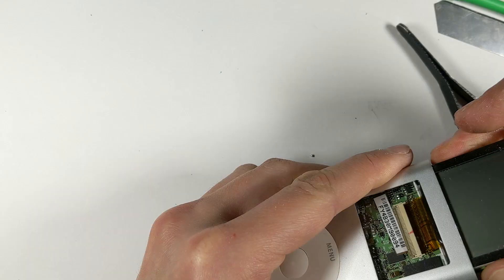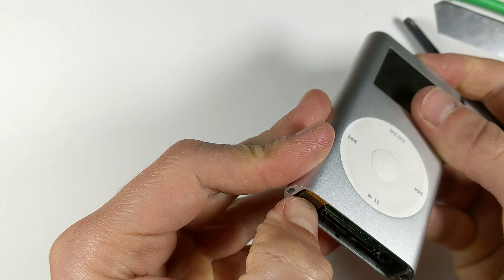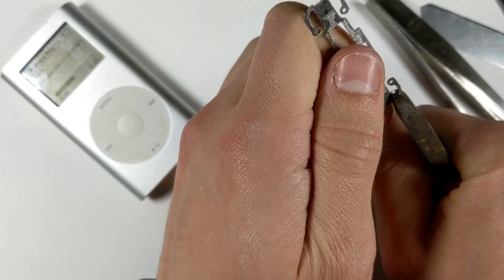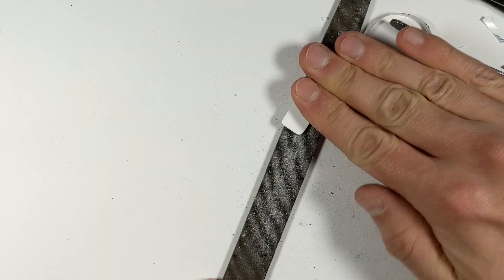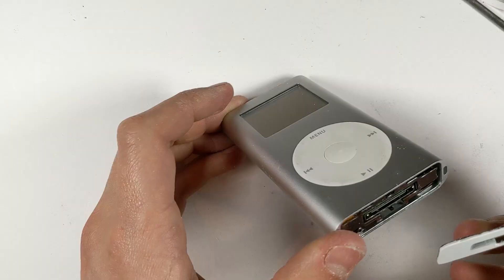After that's done we can slot the whole assembly back into the housing, plug in the buttons and install the two screws. We can adhere the top plastic back as normal using some double-sided tape. Before we reinstall the metal bracket at the bottom we need to cut it down a bit to fit the pair button and power switch — I snip these two pieces off using wire cutters and use my cutting tool to take this part out. Then I shave down all the protrusions on the back, cut a small hole for the on/off switch, put some double-sided tape on the bottom and reattach it.